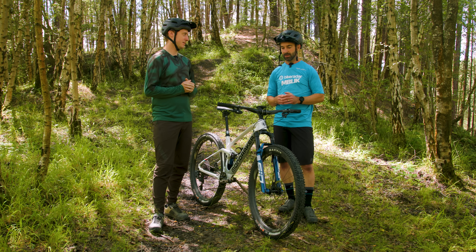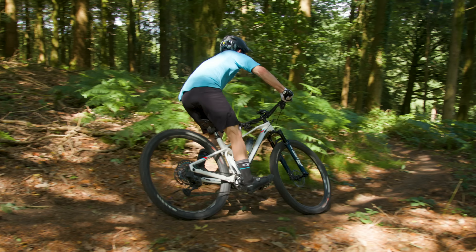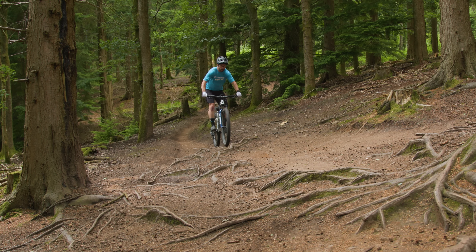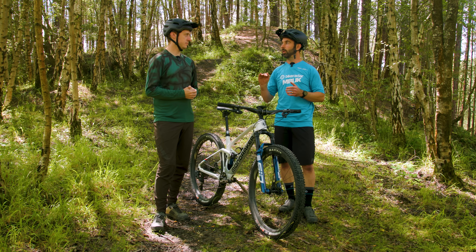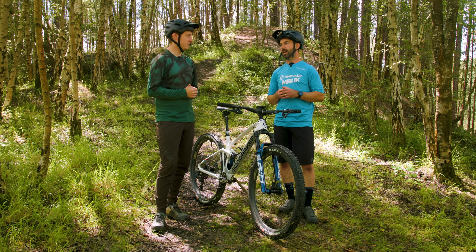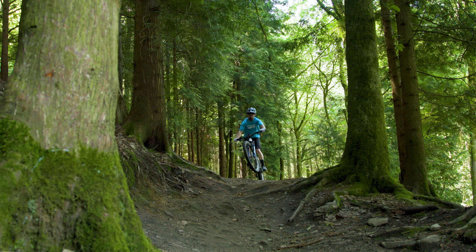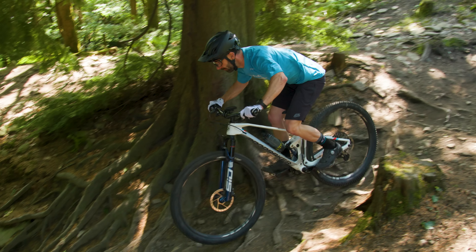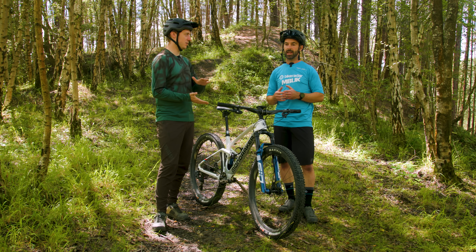On the positive side, first and foremost they're super sensitive — just like the old one was — but this feels that bit better at keeping the front wheel attached to the ground. It feels like you can generate more grip from fluttering in and out of that initial part of the travel, and also on heavy impacts. The old fork ramped up a lot — you really had to smack it to get full travel, and a full bottom-out was almost never achieved. Whereas on the new fork you can achieve it, and it's not a harsh metal-on-metal bottom-out. You feel like you're getting your money's worth from the travel and can use all of it, which helps with setup — you're not trying to run it softer just to compensate for that steeper ramp.